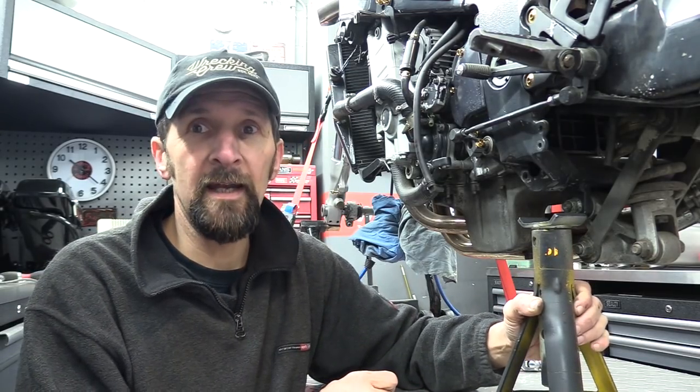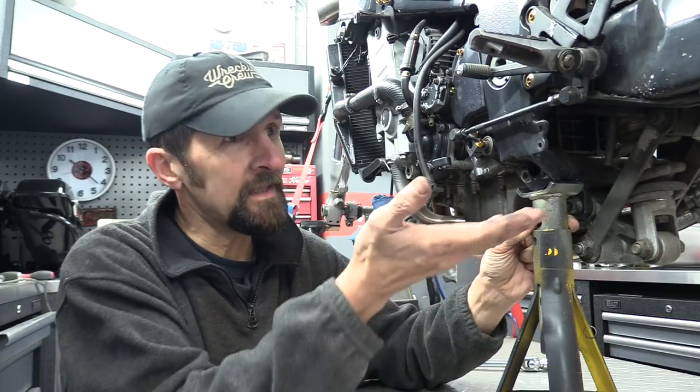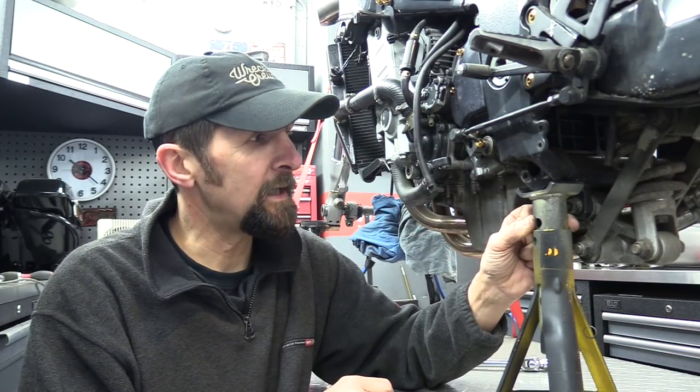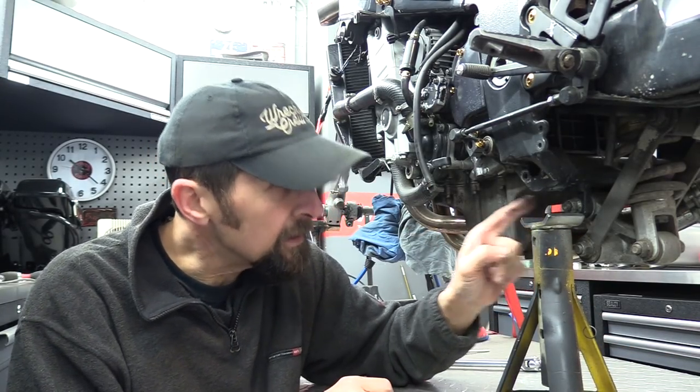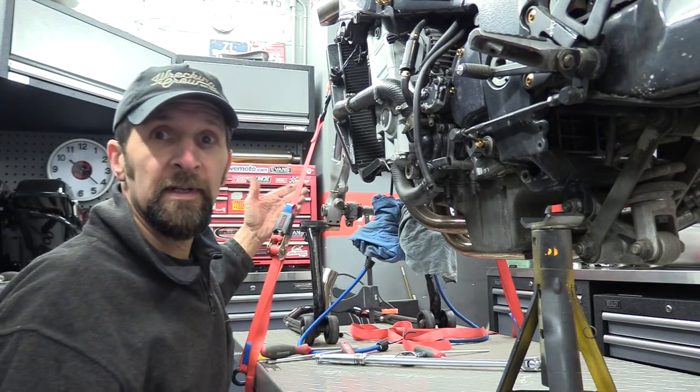I can bring the axle stand in under there, and I can come up under there nicely once I've jacked it up a bit to get the weight off the paddock stand. And the same goes for the other side. The other end of this just pokes out enough to get an axle stand under. Naturally, always, whenever you're doing this kind of daftness, strap it down.